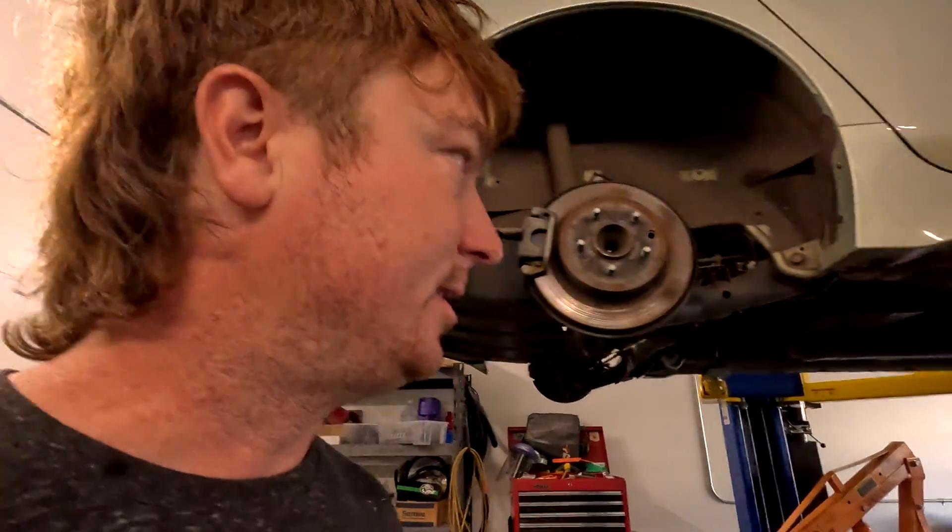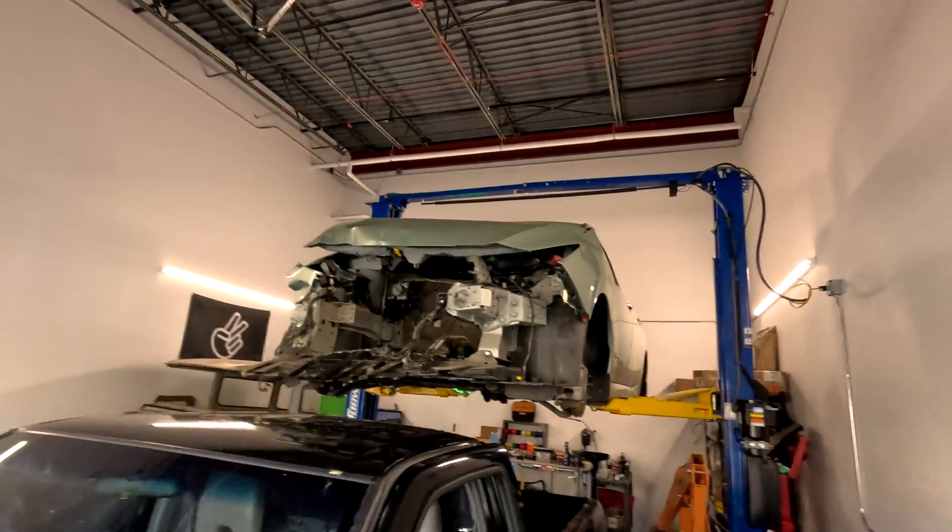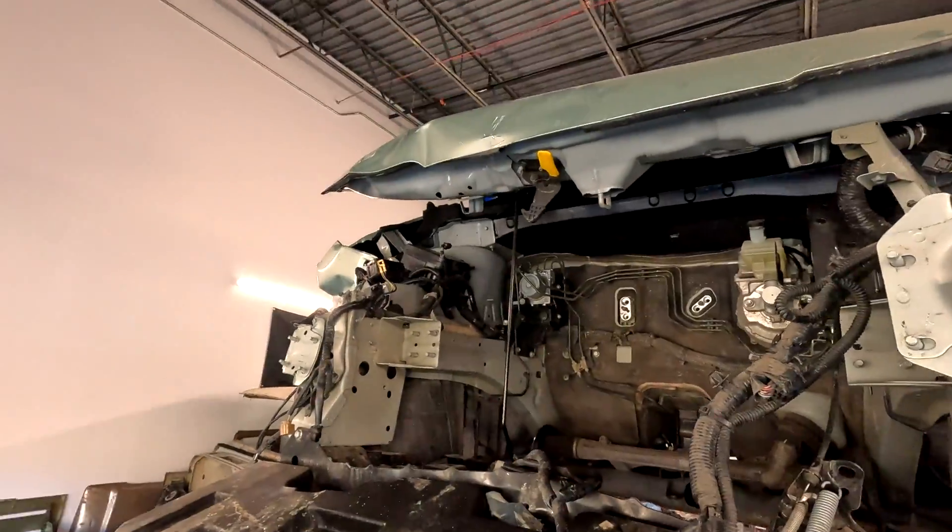So that's about it for the car. You can see this is where the battery goes in the Leaf and it's all been removed. It's very easy — there's only about 10 bolts around the outside and the whole thing comes out. It weighs a ton but it's pretty easy to get out. Having a lift is absolutely totally worth it — without the lift I'd probably still be working on it. You can see the motor has been taken out of the car — it's totally gone. Any wiring harnesses that I thought we'd need I went ahead and trimmed those out also.